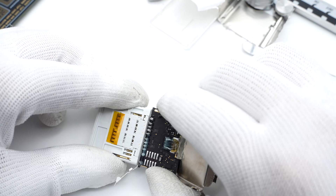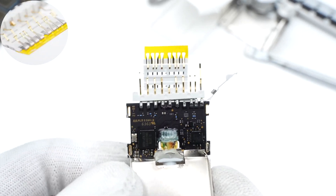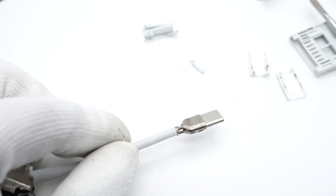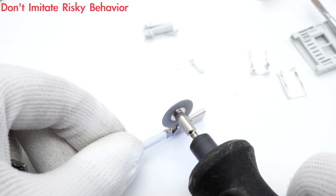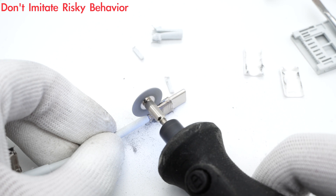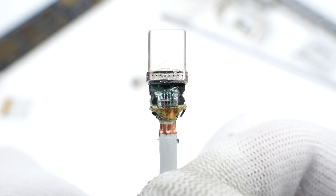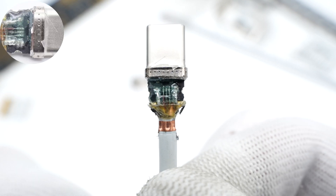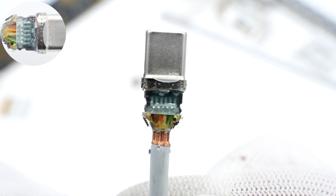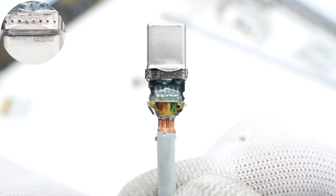Remove the plastic frame and then we can take a closer look at those pins. Finally, let's take apart the USB-C connector — use the cutting machine to cut it open. There is another thicker steel shield to protect the connector, just like the other two parts. Here we can take a closer look at the junction. All the coaxial and shielded wires on the front and back are soldered to the PCB. The solder joints and wires are reinforced with a huge amount of glue. A tiny coat can be seen on the end of the connector.